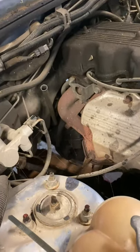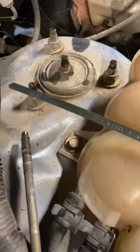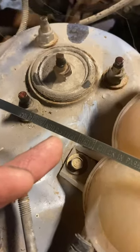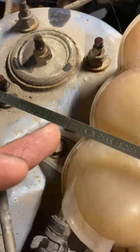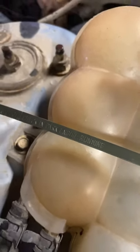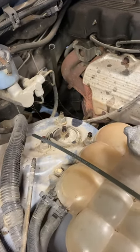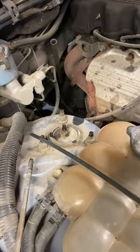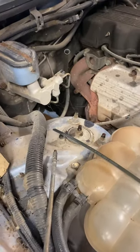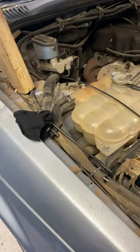I should remember this is not a BA Falcon — it actually has a dipstick. So to check the right amount, you can actually check the dipstick. It's got where it should be when it's cold, it's telling you to add half a litre, and that's where it should be when it's hot. And it even says check in park with the engine running — how good. So I've put just over 3 litres in there, because 4 litres would be for a completely empty system and you'll have some in the torque converter. So around about 3 litres I'm hoping will be enough. Let's get this thing out of the ground and run through the gears.